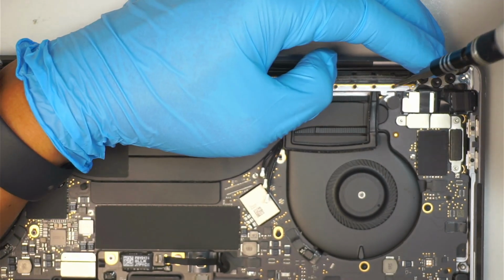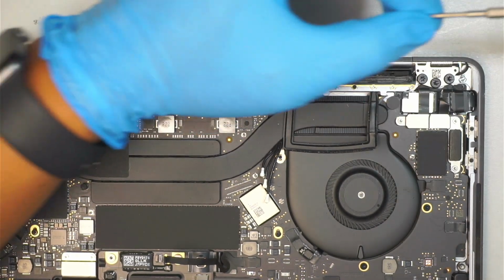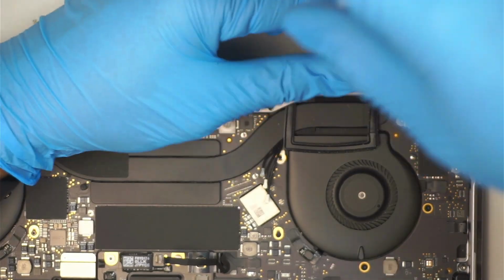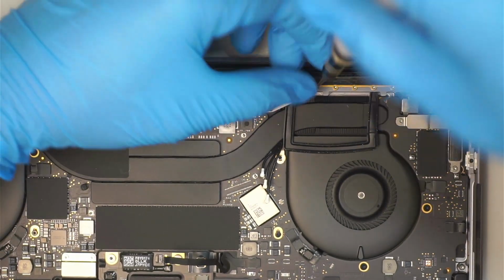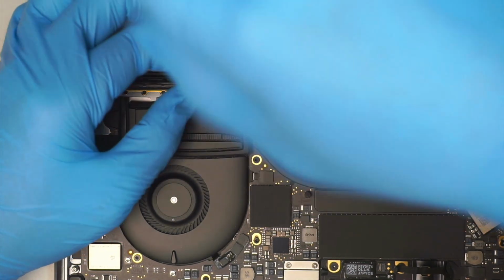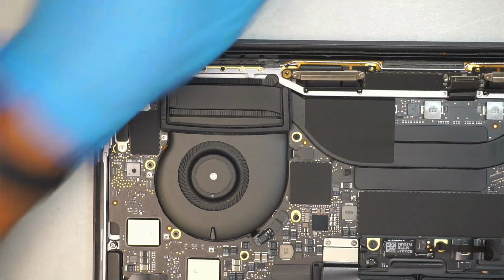You want to be very careful when you remove the Wi-Fi antenna screws, because they are really tiny. They're very easy to get stripped. So make sure you have the right tools. Make sure you have the right grip when you turn it, confidently and not tilting the angle on your screw to strip it. But for whatever reason that you strip your screw, you don't have to panic, because I made a separate video on how to remove a stripped screw. So go ahead and check it out. I'll link it down in the description below.